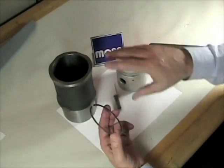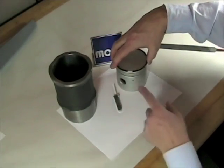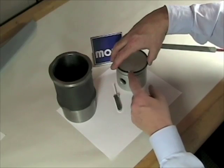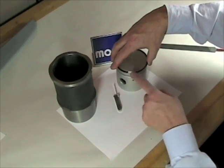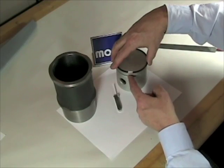When you're done and your ring gap is good and all your rings are going to be the right size to go in there — imagine this ring down here on the first groove. There's going to be a small gap at the edge. What we don't want is the gap from the second ring and the gap from the third ring to be in a line like that.